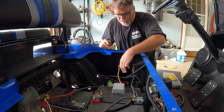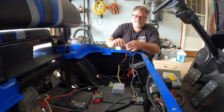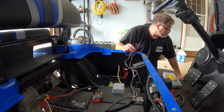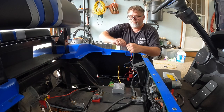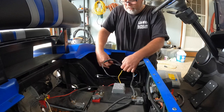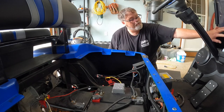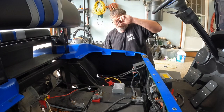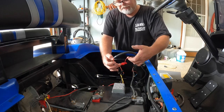So now that's working, we can take all these 12 volt accessories. We'll put the grounds together. Now this one I got here is good for 25 amps. You can get them for more than 25 amps depending on how much money you want to spend, but we only need 25 amps for what we're doing. I don't have any connections — I'm going to have to buy some plugs and rewire this later, because I like to have plugs so I can unplug this stuff. Get that a little melty melty. Take the two hots, trim them back, twist them together. Scared the shit out of me — so we know that worked. It would be nice to put a little kill switch on this stuff too so we don't have any drain. But there we go, there's our 12 volt setup. And how come that looks like such a mess? Oh, I hate messes, but there's no way around it.